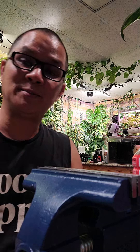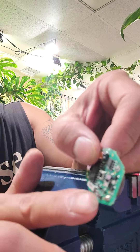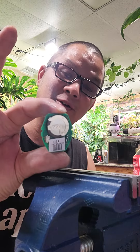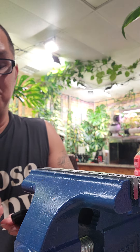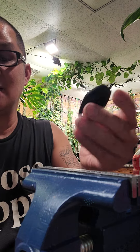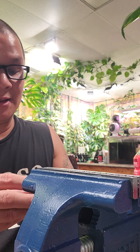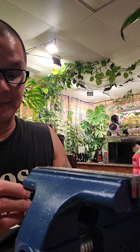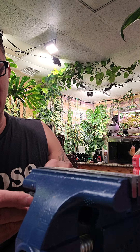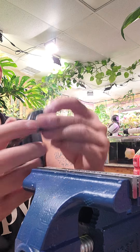I think they have this battery available on Amazon, and if I can get it soldered on to this soldering point and this soldering point, I'm going to save about $350. Then you're just going to put it back together like that and glue it — 350 bucks is what you save if you can change your own battery on the key. When you put it back, just super glue it on the sides and that should be it.